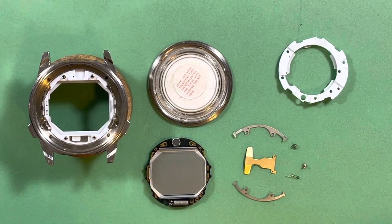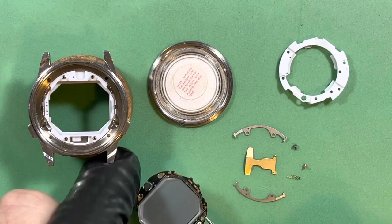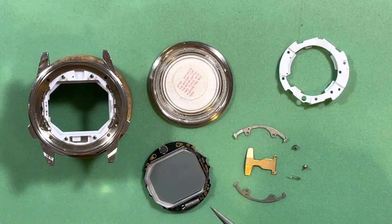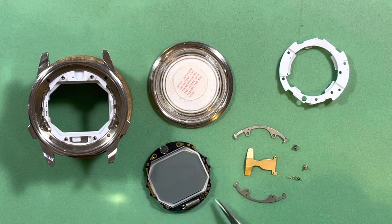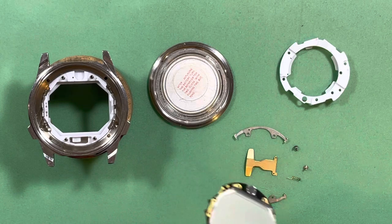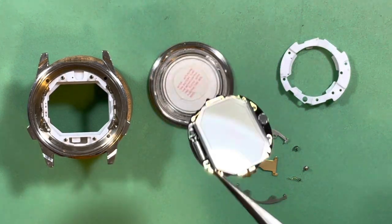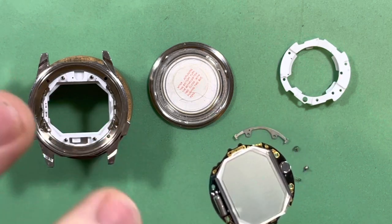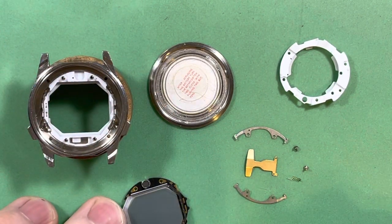Okay, I'm on the final stages of reassembly. There wasn't anything dirty in this, but when I do a quartz, you always need to check — it can look fine, but there can be corrosion or battery residue on the inside, so you have to pull everything apart and check all the connections. One of Seiko's amazing innovations: these little gray strips that hold the LCD panel are a kind of conducting material that has conducting and non-conducting elements that talk to the LCD connections inside the screen.